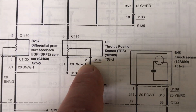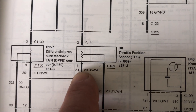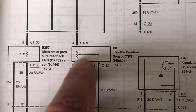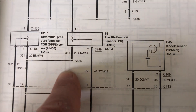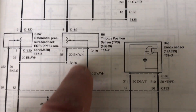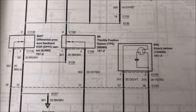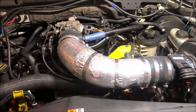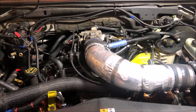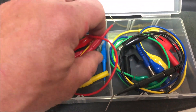What I'm going to do is test the voltage coming off the signal wire as I move the throttle to see if it moves from one volt to five volts smoothly. I want to make sure I have five volts going to the throttle position sensor and a good ground. To do this test I'm going to need the key in the ignition in the run position — but do not start it. That will send signal to the throttle position sensor through the ECM. I've got a back-probe kit that lets me probe these connectors without destroying them.